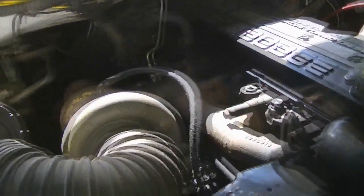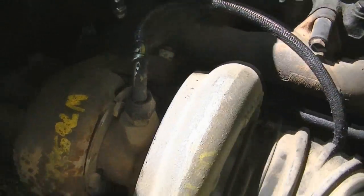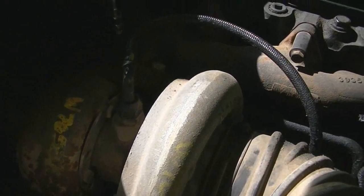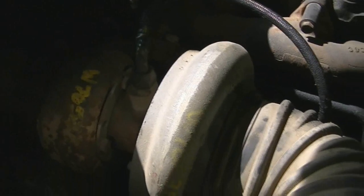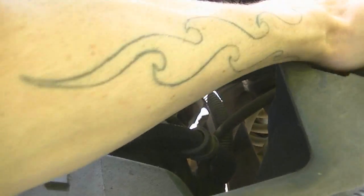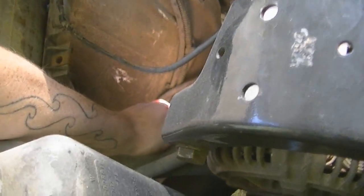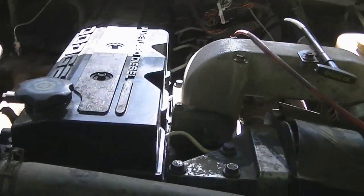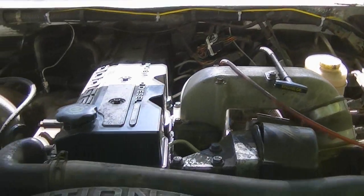The turbo's getting a bit toasty — I can see smoke coming off it. It's just burning off all the crap that's been on it from however long it's been sitting. Sounds like the coolant's circulating, but it's not even hot. It doesn't even sound like there's coolant in the top hose. The bottom hose is warm but the top hose has got nothing in it, so I'm probably going to have to top up the coolant. Can't wait to get this thing going and drive her.